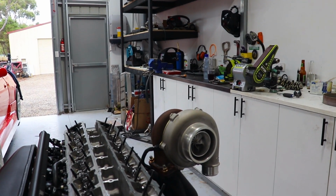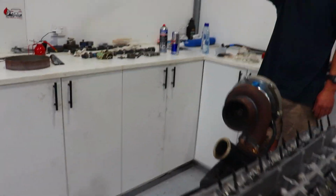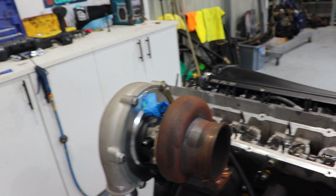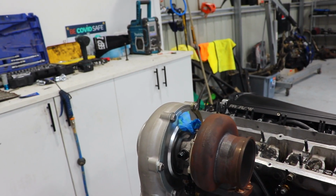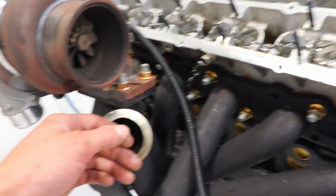So we're good for about 480 kilowatts. Bigger compressor wheel, I think. Bigger compressor wheel, still got a smaller front housing. Same rear housing as yours, bigger compressor wheel, 450 kilowatt. 474, on stock cams. Got the six boost manifold, going to be running a 50mm gate.